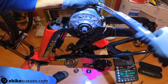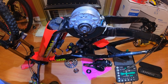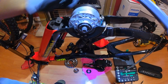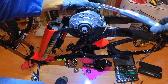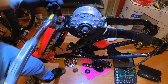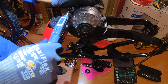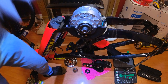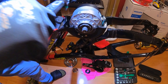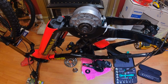That's 10 Nm done. Now bump it up to 15 Nm — 15, not 50. Go easy with the torque wrench, gently. That's 15 done. Now the final torque-up: 15, 16, 17, 18. Confirm 18 Nm on both sides. What an achievement — the motor bolts are properly torqued.